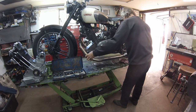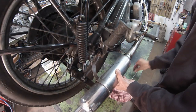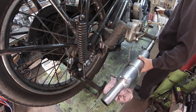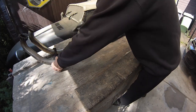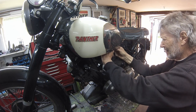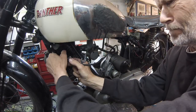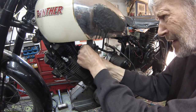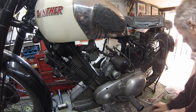First for removal are those components with a leg in both camps. Attachments to engine and frame, like the exhausts. Two of these, on a single cylinder motorcycle, must be P&M's greatest extravagance. Fuel lines come off the tank next, and the high tension lead from the spark plug. Two bolts from the carburetor flange and the threaded top ring set the slides free with their Bowden cables.